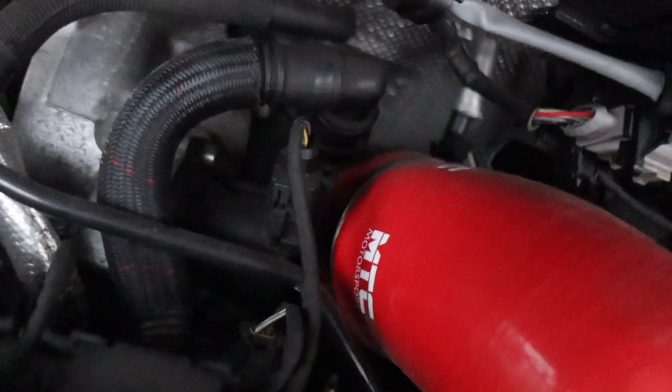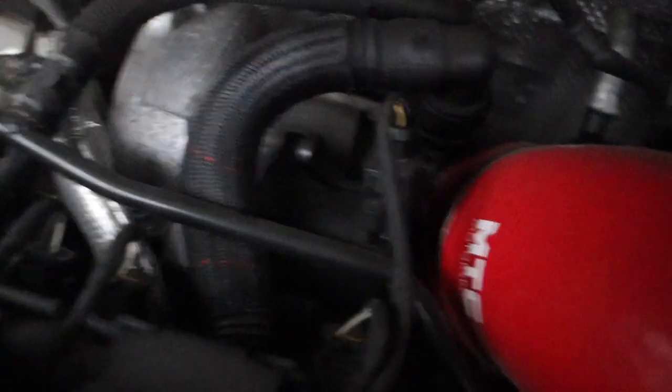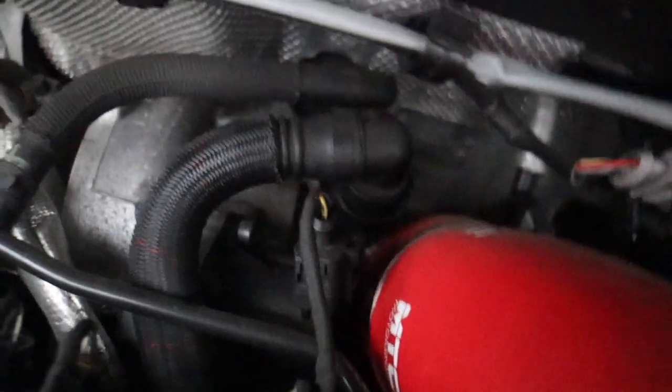You've obviously got your intake hose and then separately you've got your aluminium turbo elbow - that standard one comes in plastic and it's restrictive. Once we get it off we'll see - some are three inch, some are smaller.